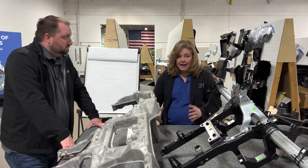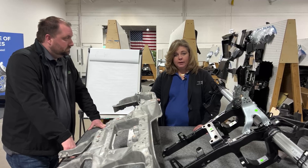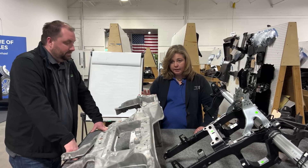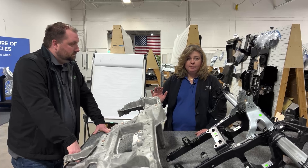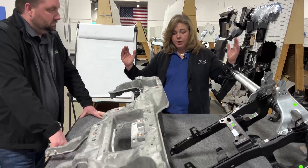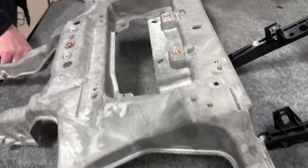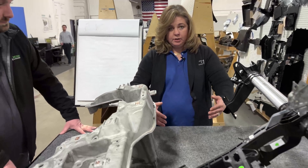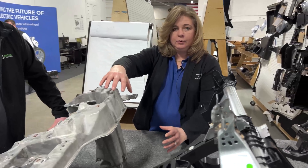This is not ideal because a large part of the purpose of a cross car beam is to add structure that enables the safe enclosure of the occupants, especially in the event of a T-bone impact. About a quarter of all fatalities in auto accidents are from a T-bone side impact. This cross car beam rigidifies the car between the A-pillars so that when the car is hit, those loads are transferred across the car and the occupant space isn't crushed. It also prevents the firewall from intruding into your space and holds the steering column where it belongs.